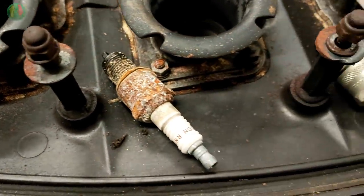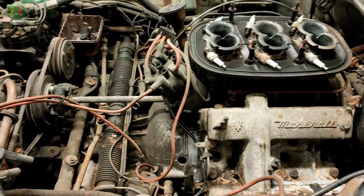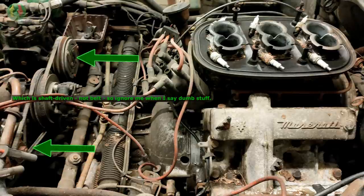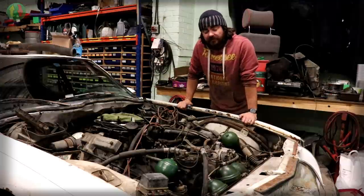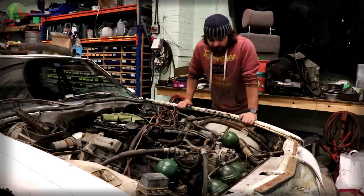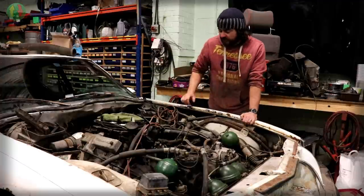What I'm going to do now is remove the belts from what they actually call a rack of stuff - the air conditioning compressor, the alternator, and the hydraulic high pressure pump, because they all add load. Once the plugs are out and the belts are off, there's the least amount of load on that shaft possible. Assuming I haven't done something stupid like leave it in drive. In theory that means I'm fit to try doing something you really shouldn't do.